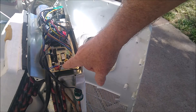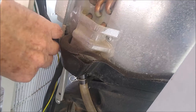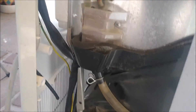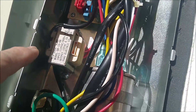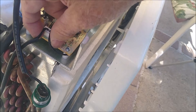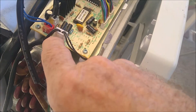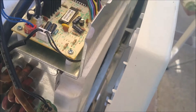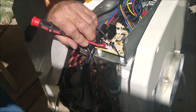What we're looking at is right here. These wires here — this is a sensor that goes down to the evaporator. There's a second sensor on this wire right here. What this sensor does is it samples the ambient air temperature so the computer inside the control board has the ability to compare. That runs along here, up under here, under this transformer and along the board, and is plugged in right there. You see the two of them come in right in this area. Right here there will be a kind of hot glue that holds the thing in so it doesn't move. You're going to want to take something like a small jeweler's screwdriver and just kind of work that stuff off of there to pop this thing loose.